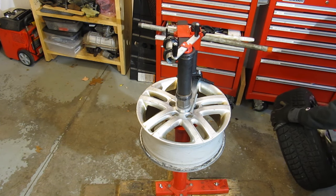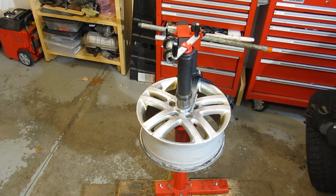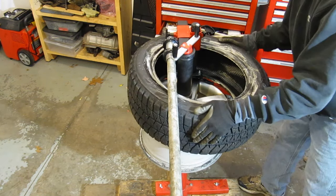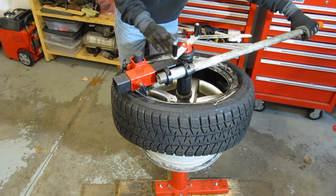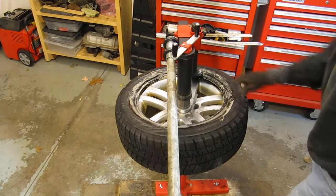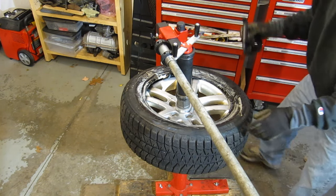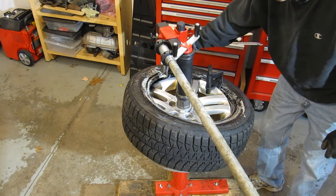Making sure the lubrication is the same to be fair, and popping it in place. My concern about the tire riding up over the rim was unfounded — it does seem like the tire, as it's going on, still sits above that lip, so that's not a problem. Overall I think it actually took a little bit less force using the black duck bill rather than the red. I think that's because it doesn't have the bump in the back.